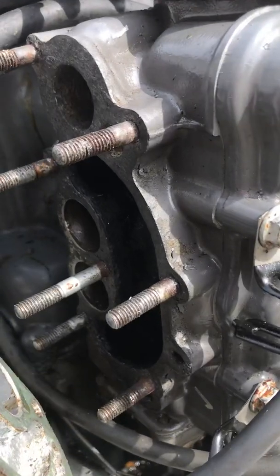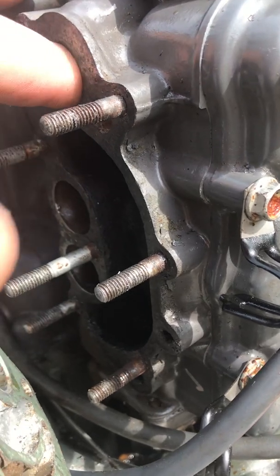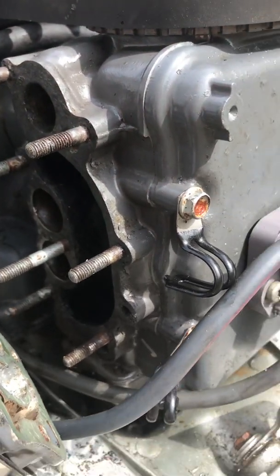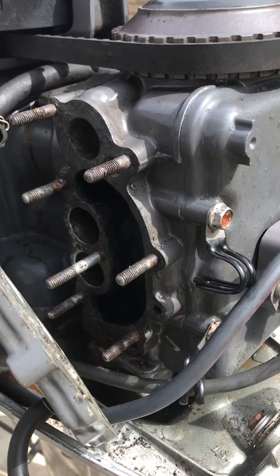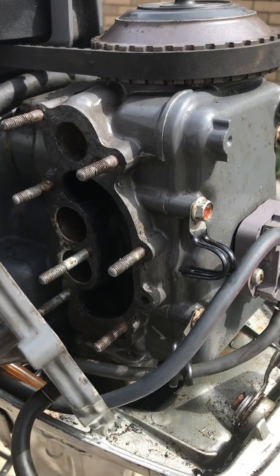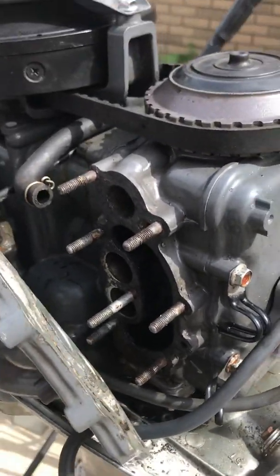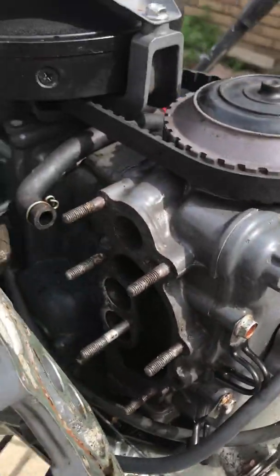You've got a lot of stuff happening right at this exhaust manifold. I think when this thermostat backed up, the water couldn't go anywhere — it pushed the water here and here into the combustion chamber. From the combustion chamber it ends up in the sump, roughens combustion, and then you end up with watery oil and a motor that won't start.